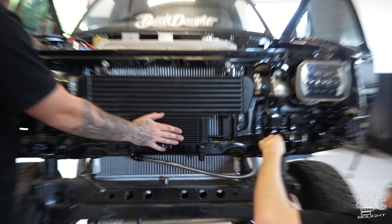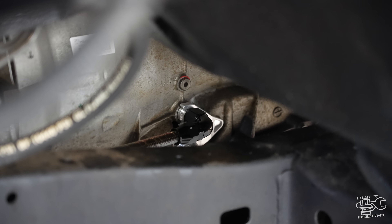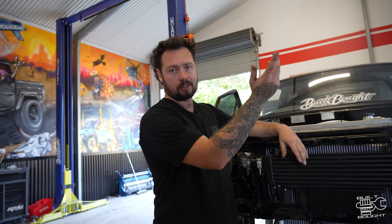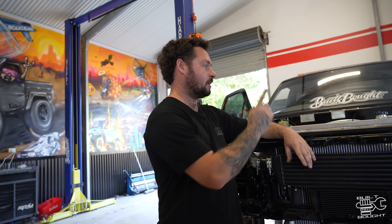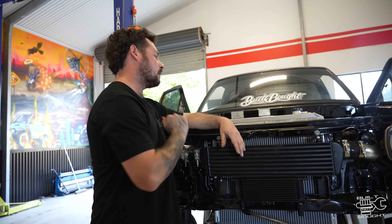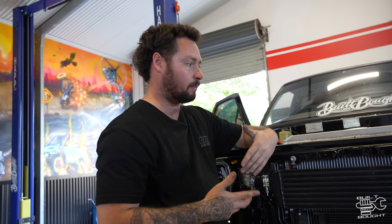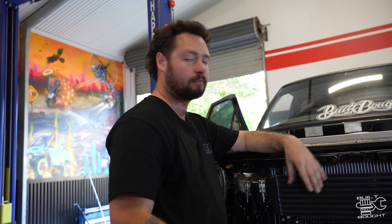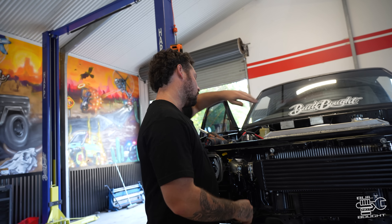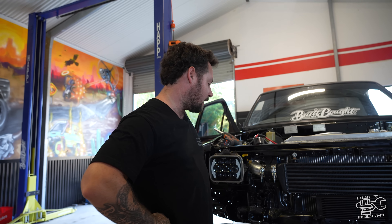Transcooler — that's important. I saw the boys at the Melbourne show who gave me some fittings to go on the gearbox, because remember last time we started it, it was pissing fluid. So the fittings are on. Got some Raceworks hoses up to the cooler. I've got one more to make and then we can put fluid back in the gearbox and it should be able to run without making a mess. Coolant we'll sort out soon. Someone put a hole in the radiator, then someone made it worse — me, by trying to fix it. So it will leak.